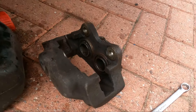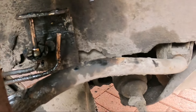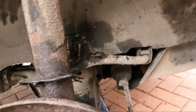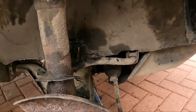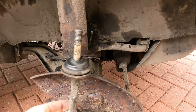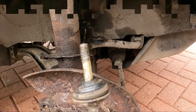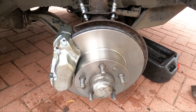Started on the driver's side to remove everything. I've removed the disc and you can see there's a massive lip on both sides, so they need replacing. The wheel bearing is good and the calipers are okay but they're not working. The biggest problem was the flexi lines — they are not allowing fluid back. It looks like it's had a problem in the past. Someone's already rounded off one of the flexi line unions and it's seized in there, so I'm going to have to fix that union and use the new flexis on that.